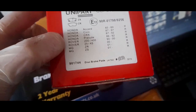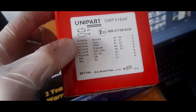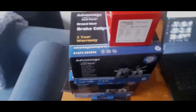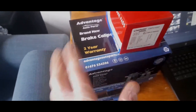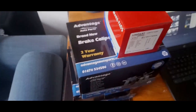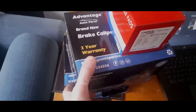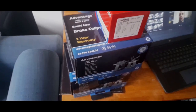All the parts are exactly the same. These calipers and pads are used on Rover R8s, the old Hondas, all the way to the later MG ZR, ZS, 25s, and 45s, so should be well applicable. I have set them off - you're supposed to rotate them, I think it's anti-clockwise and clockwise again to reset the system, which I've done a couple of times. So we're going to put these on today, hopefully bleed the system and adjust the handbrake.